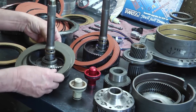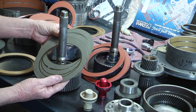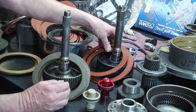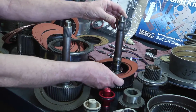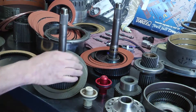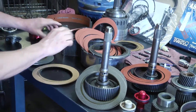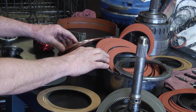On your input friction plates, your stock ones are a high energy or paper lining. The heavy duty or upgraded ones use a red plate on all the clutch packs. The stock are these, and your upgraded are the red, which is a higher quality plate that takes heat a lot better.